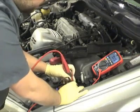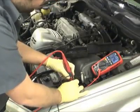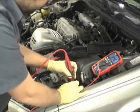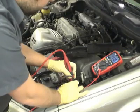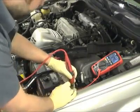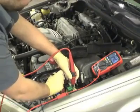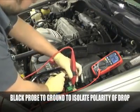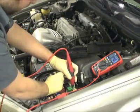Push the horn button. With our horn applied, we've got 12.46 volts battery voltage. We push our button and it drops down a little over a volt. If we want to know where a drop is, we can let off the horn. We go from positive to the negative ground, push our button — we have virtually no drop.